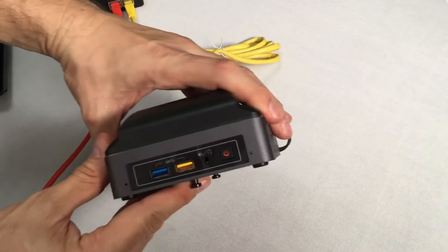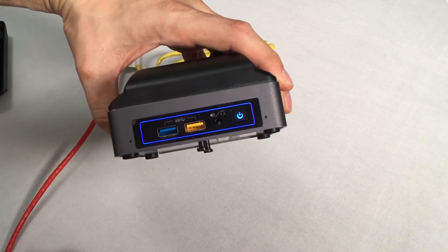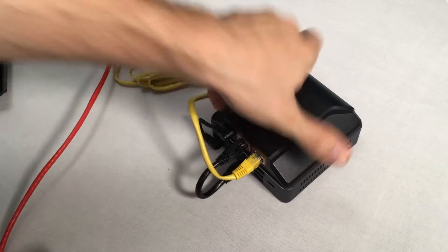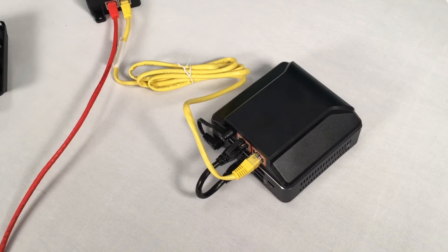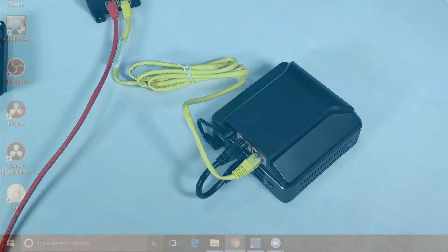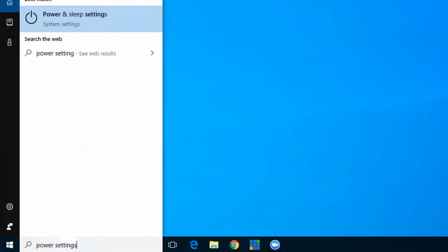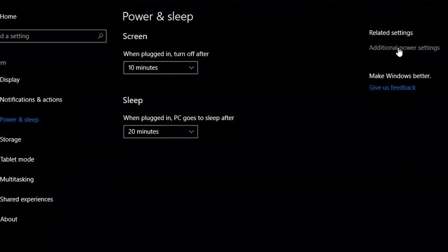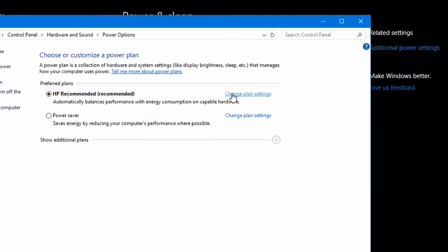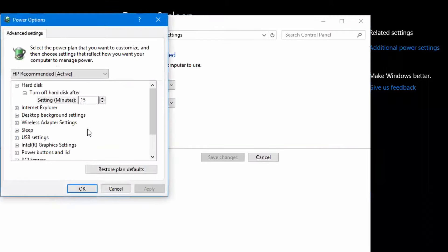Your NUC should start to boot right away. With an IEEE 802.3BT device, you don't have to do any configuration — the PoE NUC lid will work right away. However, if you're using Windows, there's a best practice I like to do: type 'power and sleep settings' in the search bar at the bottom, select additional power settings, change power settings, then change advanced power settings. I like to go with the balanced settings to keep the NUC from spiking on power.